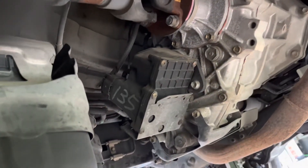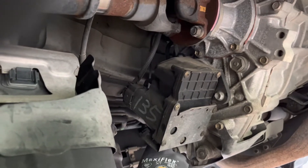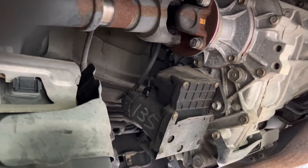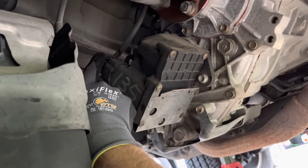There are three bolts — looks like they're all 12mm. We're going to take these bolts off, pull it out, rotate it, get it loose, and then we'll take a look at it. Also, as always, don't forget to disconnect your electrical stuff first.